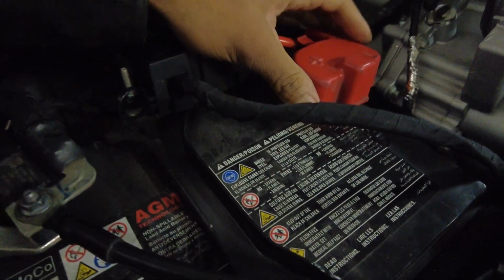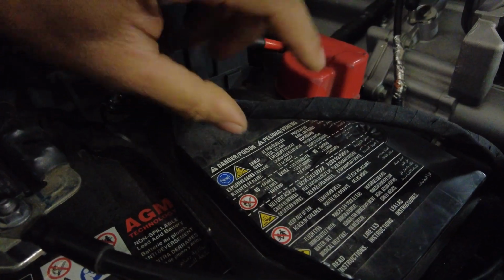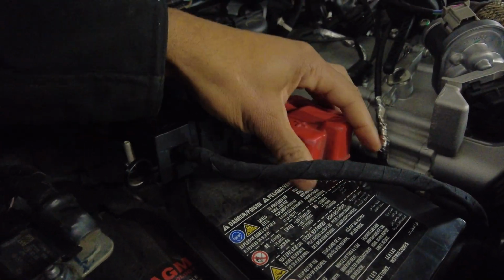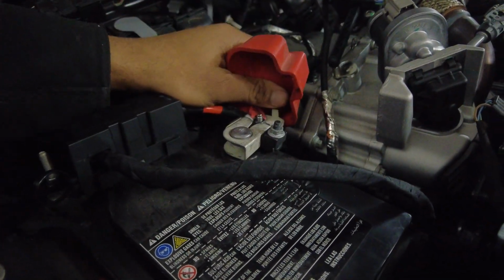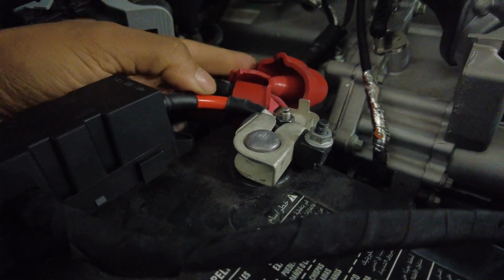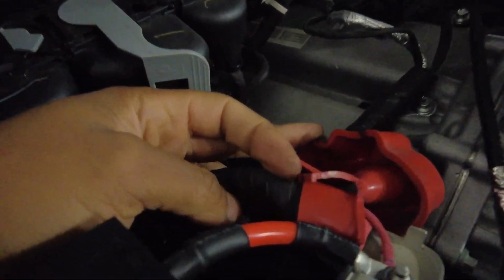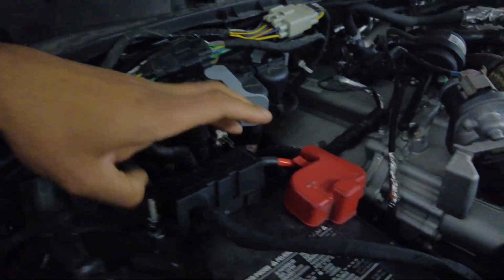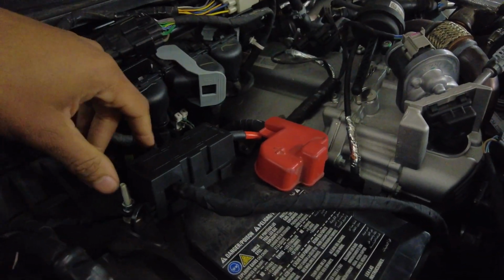And for this side, this is the snowplow wire harness, the main one. I'm running a 200 amp fuse. A lot of guys don't run the fuse. I don't get it, but I do. And I just custom made this little shorty wire in order to connect to the fuse. So I didn't want wiring everywhere. I just wanted it to look kind of clean.